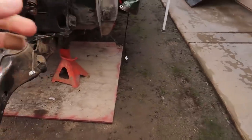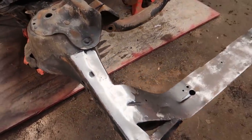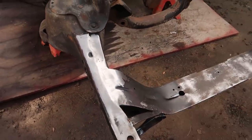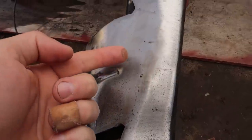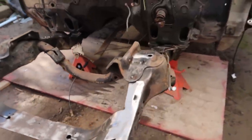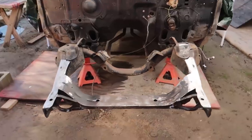It did rain again — down poured for a solid day. You can see it's still pretty wet right there. But the bare metal didn't rust, so what I did is I just coated it in a penetrating oil. If you coat bare metal in any sort of oil, it won't rust — makes it kind of water resistant. So I just soaked the whole frame down in it, and it allows it to stay nice so I don't have to wire wheel or clean it again.